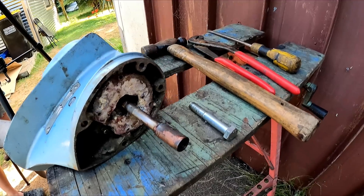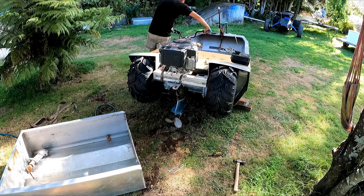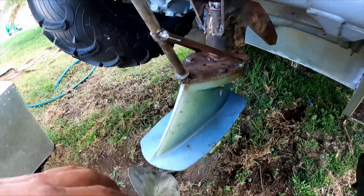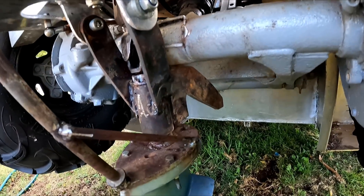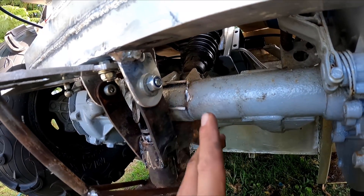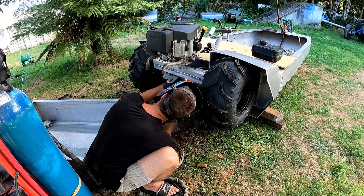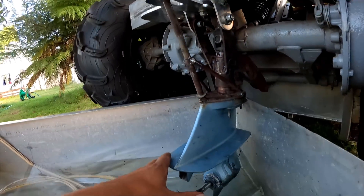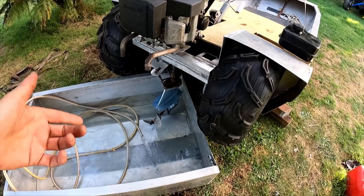Guys, I think I was just real dumb. I'm pretty sure this just leapt up and popped out of gear — I think it might be fine still. I put a piece of aluminium inside there to hold the button down, but I think we had other problems. What happens is this sits up too high and the spline is not engaging properly. What I need is a little lever off here so the top of the diff pushes against it, forcing it that way. I need to weld something on there. Alright — the diff just pushes up on that plate now, locks it in place. Bad problem is now when you hit a rock that's just stuck there, so it's going to break — but it'll be alright, it just won't hit rocks. Waiting for the water to fill up.